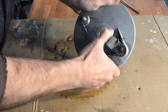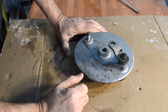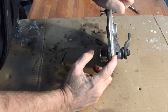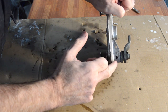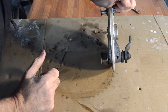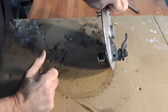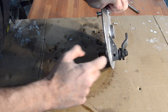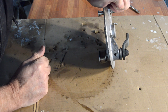As I thought, the cam is completely solid. Now there's a threaded hole here, which makes me think a grease nipple should have been fitted, but there isn't one, and there isn't one shown in the parts book. So I'm going to get this out, clean it all up, and then I think I will find a grease nipple and put it in